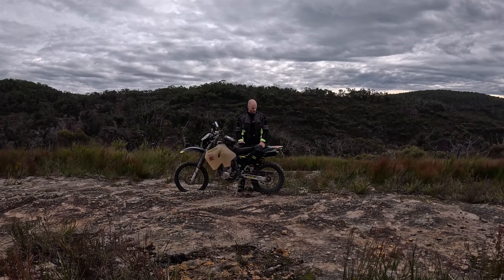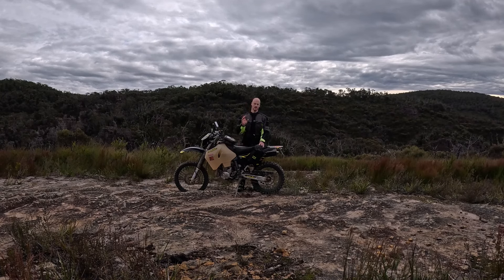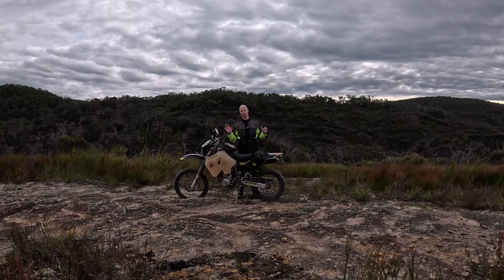However — and it's a big however — if you want to make this bike a true adventure bike, able to tackle any terrain in Australia fully loaded up, you've got to have your suspension done. In my opinion, not only for comfort, not only for control, but also for safety, because otherwise it is too soft to carry the extra load.